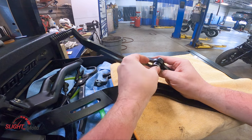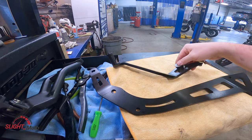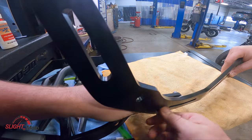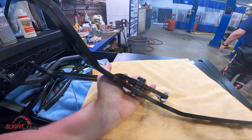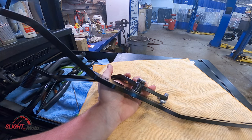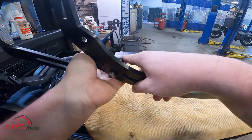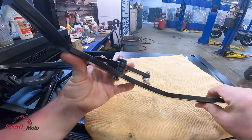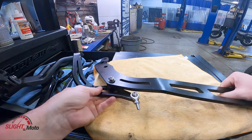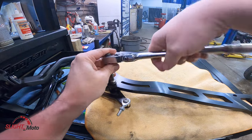So the shifter goes there. I want to make sure it's in the proper position because there are two holes. We're going to put some Loctite on it, it goes through this hole with a little bit of Loctite. They come with grease on this one — your boot needs to be lubricated. It is the bolt, the washer, larger washer. They've already greased this one so you don't need to grease that. We just tighten this up with an H5, hand-tight for now since final torques are done at the end.